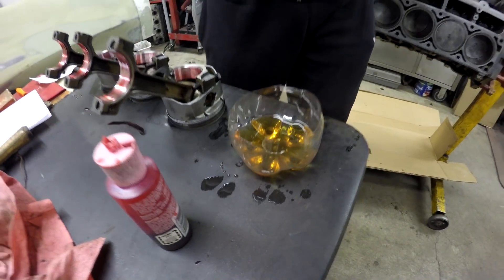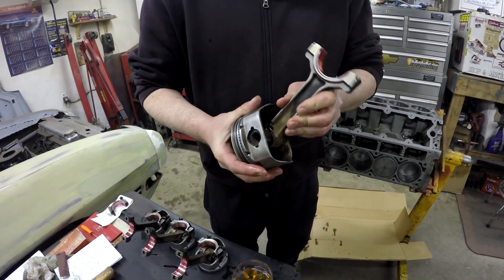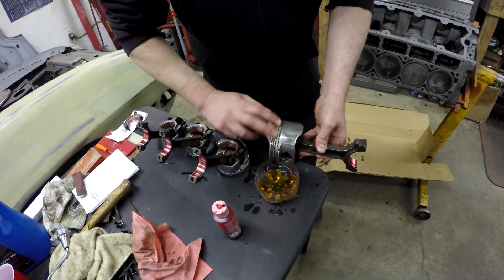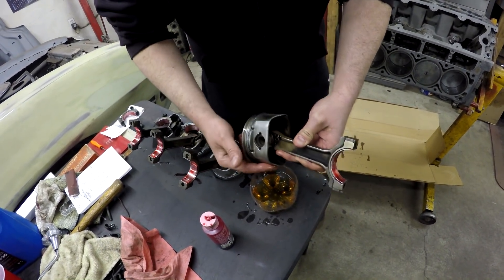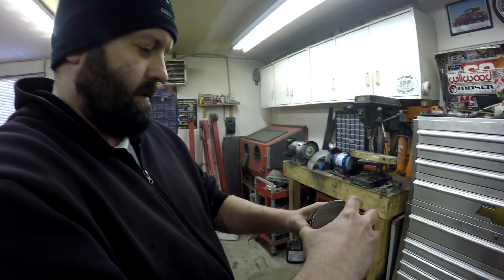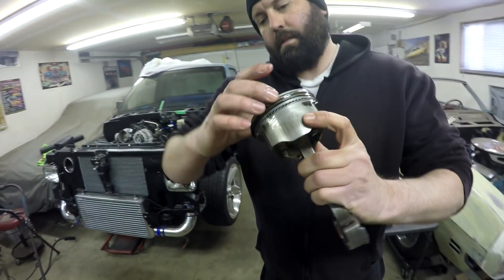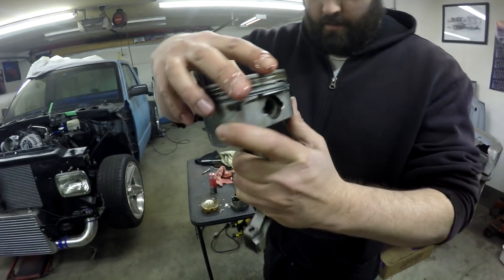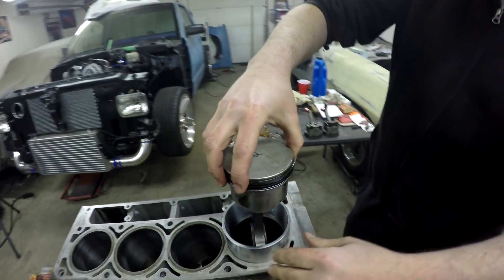So for that first startup there's good oiling and lubrication. We've got a goblet filled with oil — just gonna put a bit of oil on the wrist pin, a little bit on the rings, and a little on the skirt. First and second ring: I just clocked the opening one at 270 and the other one at 90. Basically you don't want them lining up is the big thing — they spin once they're in there, so it is kind of what it is.